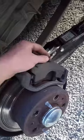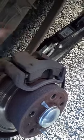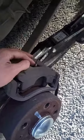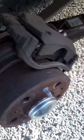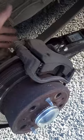I'm going to take this off. As you can see, the wire's chopped through on the brake wear sensor there - that was done before. I'm going to take that off. That's two bolts at the back - one and one underneath. That'll come off. We'll prop it or tie it up out of the way so we don't damage the hose.